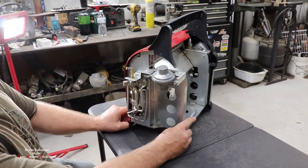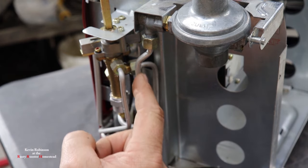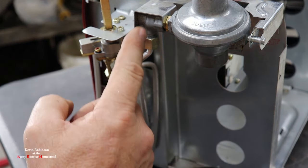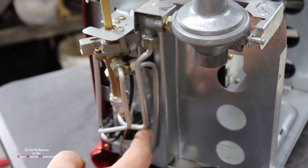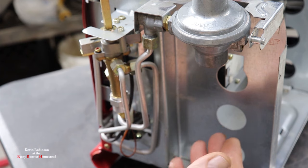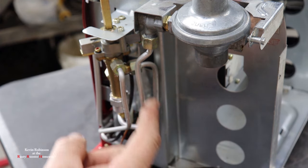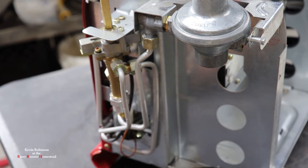We're going to turn our heater to look at this side — this is the side we're going to be working on. The issue that people have is this line right here going to your regulator, coming over and going down. It comes around and hooks in on the back side. The reason they have issues with this is it gets filled with oil. The reason there's an oil residue inside is because liquid propane is made from oil, and there's always a little bit of residue in liquid propane. I use a filter on mine, so I'm thinking the filter will keep that oil residue out of my line. So let's open this up.